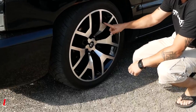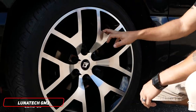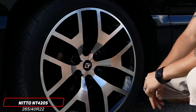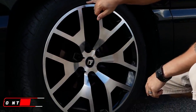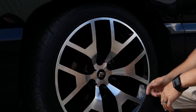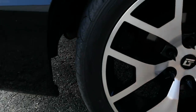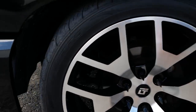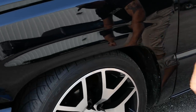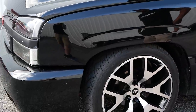And then for wheels, you're gonna see they're the 22x9 OEM replicas, and it's a plus 30 offset. It's wrapped in a 265-40 R22 Nitto 420S. That's gonna be about a 30.3 tall and about a 10.4 wide. What that does is it basically only made us have to do a little tiny trimming on the bottom up there, and nothing back here with no rub. So that 30.3, 10.4 on a 9-wide plus 30 is a perfect fit when you get into the 4-6 drops on these 1500s.